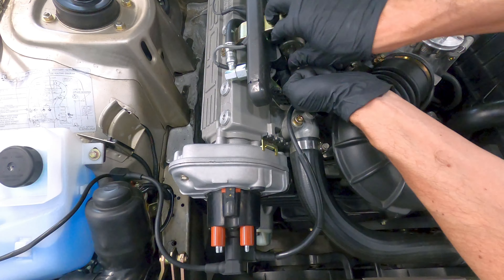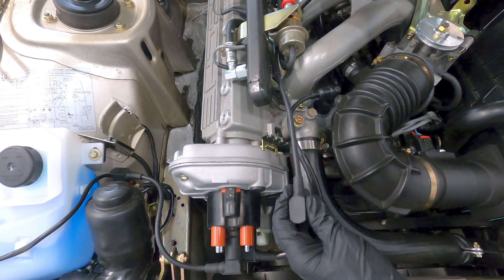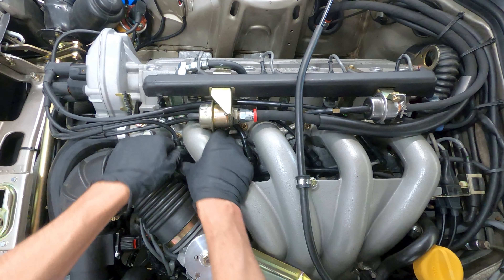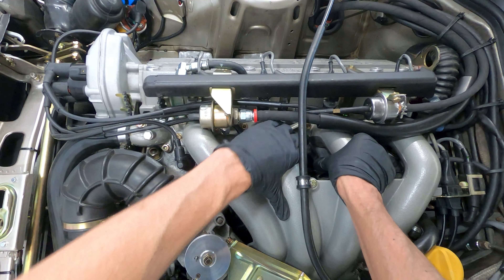It's a good idea to run the full length of each cable, twisting and flexing the material to check all surfaces, or you may need to remove them from their plastic retaining clips to get a clear view. Look out for any areas where the cables or boots may be resting against metal engine components, as burns and abrasions are more likely in those cases.